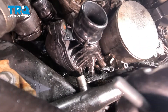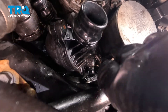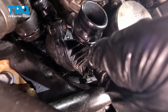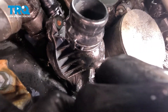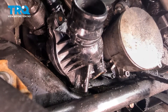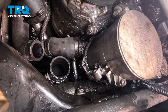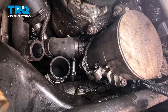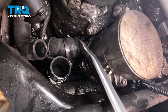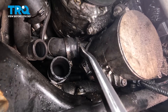Take that bolt out, then get the other bolt and loosen that up with the wrench. Slide the bolt out, grab the thermostat, and it slides right out. There's a hose on the back of the water pump that goes to the side — you gotta release the hose clamp on that. Just use a quarter-inch socket; I'm getting this from underneath with a universal adapter. Just try to pry this hose off a little bit to break it loose — you don't have to take it off completely yet.